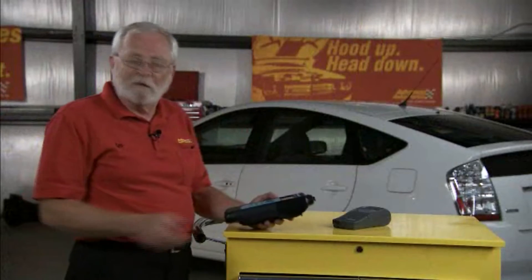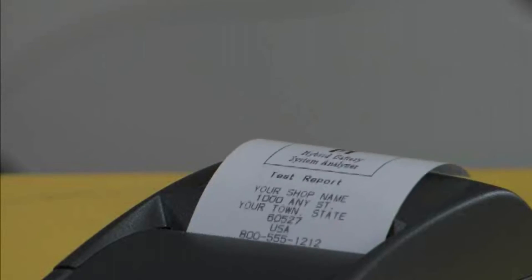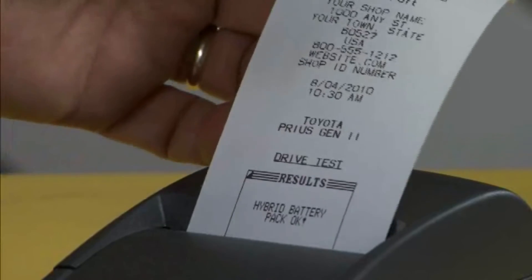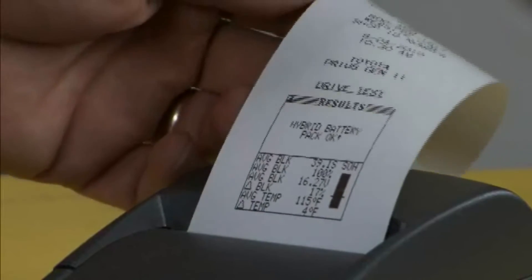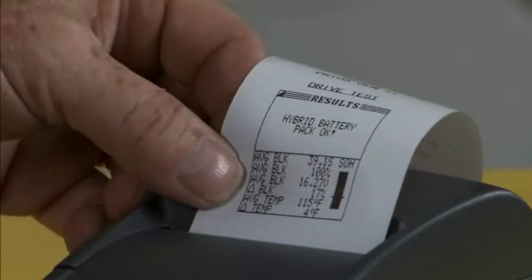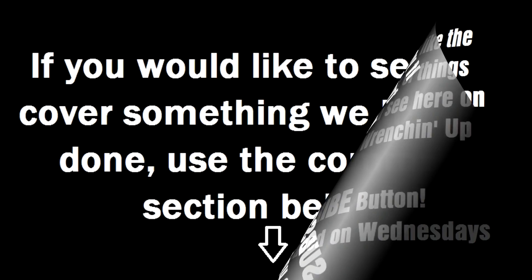The printer that comes with the tester is wireless, so all we have to do is aim the tester at the printer and we start getting the printout. This is going to be easy to analyze because the printout gives us the average block voltage and the temperature spread across all the modules. There'll even be an indication on the printout that says whether the battery's good, out of balance, or needs some sort of service. As we can see right here, we have a good battery pack. We can look at the average block voltage, the conductance, the temperature spread, and there's even an analog bar to give us a quick diagnostic of the battery state of health. We'll see you next time.